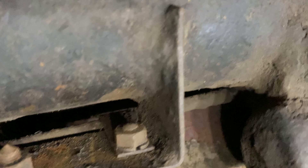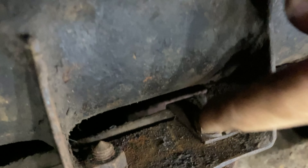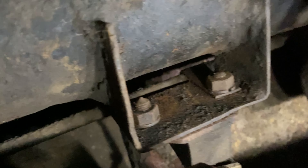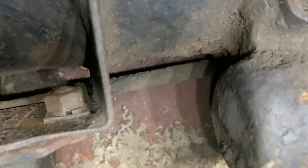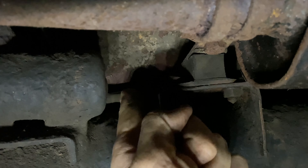That was very easy — I'll leave the petrol line out of each little clip. I'm now back by the rear suspension; this is the shock absorber here. This clip is slightly different in that it's not clipped to the chassis — it's actually held on by a nut and bolt, which also holds the bracket for the exhaust. I'm going to try and remove that, and hopefully it will free up enough room to wiggle the petrol line out of its clip. I've now managed to get the little clip off and the nut, which has freed up the petrol line slightly more. I've loosely put the clip back on because I was worried I'd lose it.